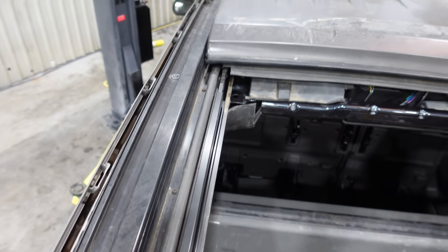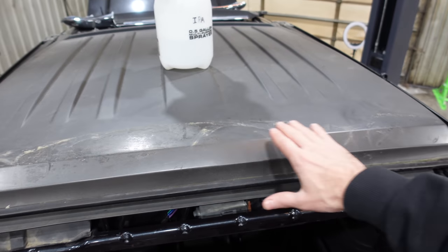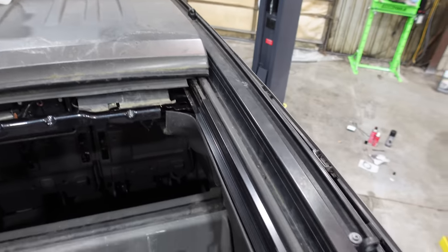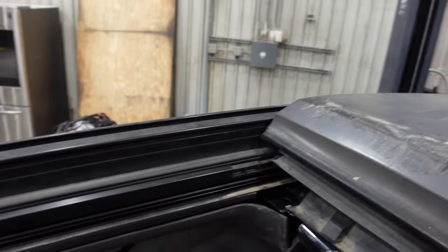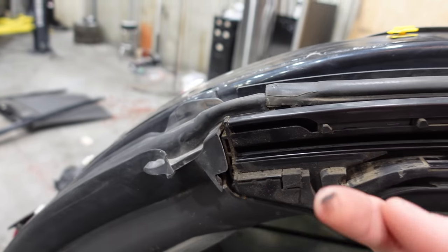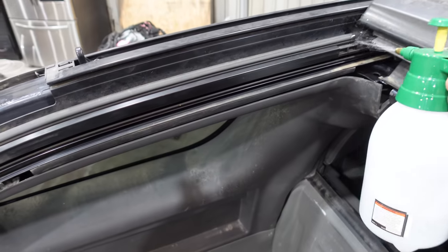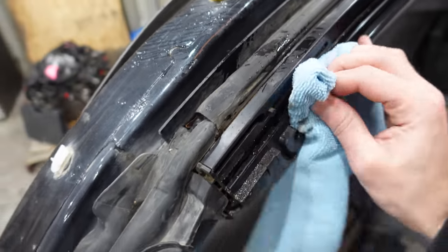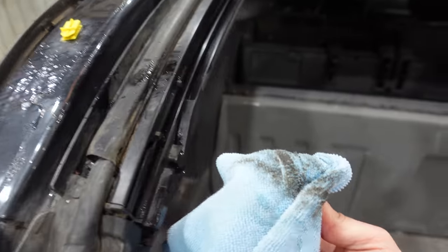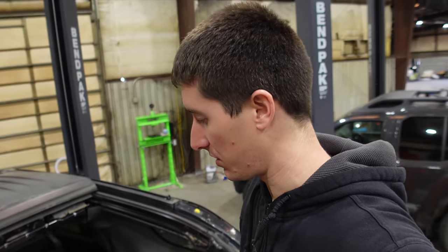The rails on this thing need a lot of help — they're full of dirt. Also, this had crash wrap on it because the glass was probably broken out, so that needs a lot of help. It's very sticky; everything you touch to it just kind of stays there. We're going to clean this all up with IPA. The most important thing is the tracks where the roof slides — you can see that big layer of dirt inside there. The goal is to get all of that out. So I have this IPA sprayer and we're going to spray it with a bunch of alcohol and wipe these things out.